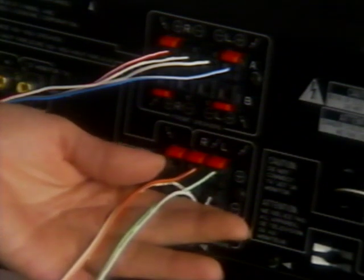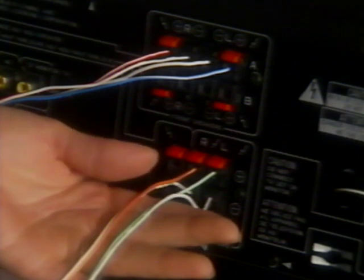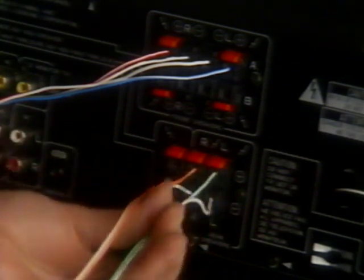Use the green and orange wire pairs to connect the two rear speakers to the back of the receiver where it's labeled rear speakers. Green for the left rear speaker and orange for the right rear. One more speaker, the center channel speaker. Find the yellow wire pair, connect the two ends to the back of the receiver where it says center channel speaker, and connect the other end to the speaker itself. Now the FM antenna for a little late night listening, that goes here, and that's it.